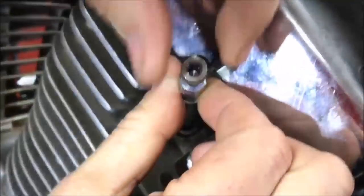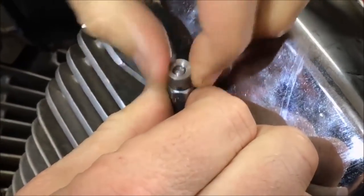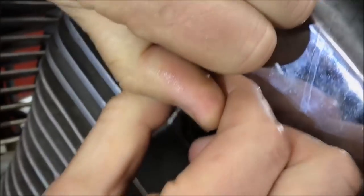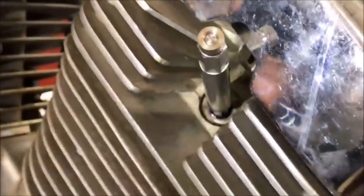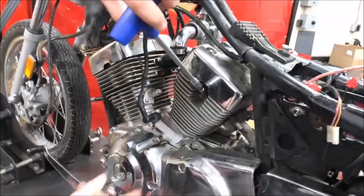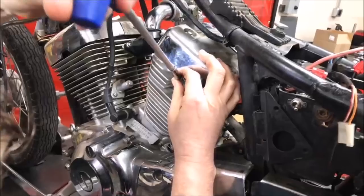There we are — see how I'm in there now? I could pull this through right now. Just like that. I'm going to firm that up. Now I'm going to try and find a good thread to grab onto. This is the challenging part because I might be cross-threaded all the way through. So I'm going to switch to feel and use a T-handle instead of a ratchet, and try to find a good thread to pull through.